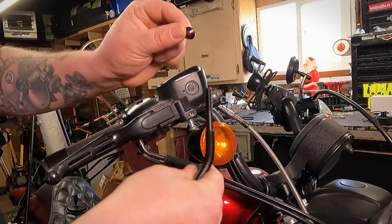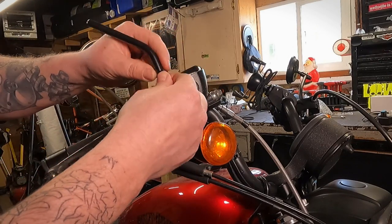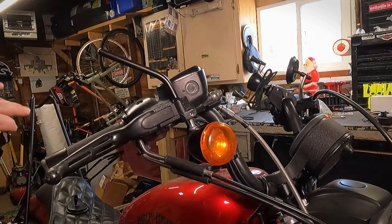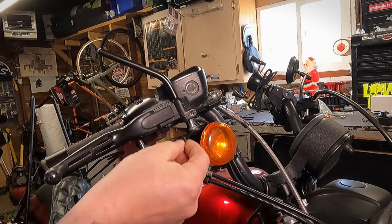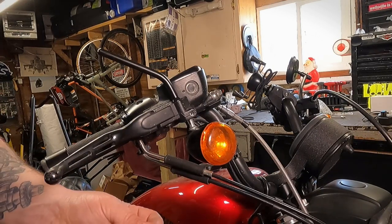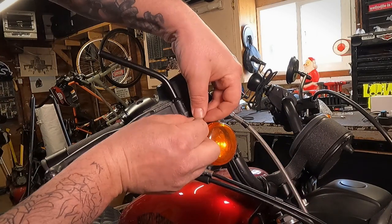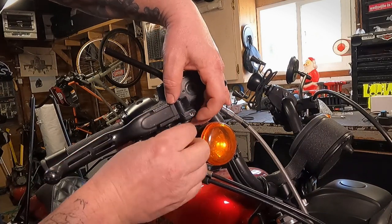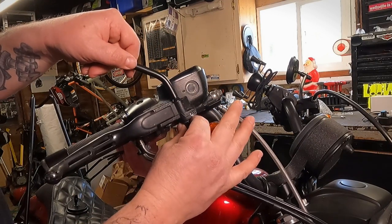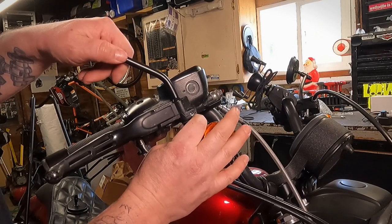For visual aesthetics, I'm going to take that taper washer and put it on there so that when it's mounted, the taper side will be pointed up — it'll give a nice clean finish right there. Then we're going to take one of the flat washers — that'll go on first. Then the lock washer, which is the one with the split in it, and then the nut will go on the bottom. We're going to put these up on there, try not to drop anything, and thread the nut up on there. Righty-tighty that on there.